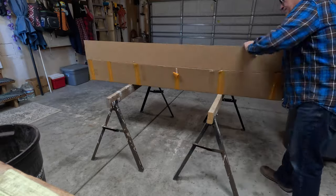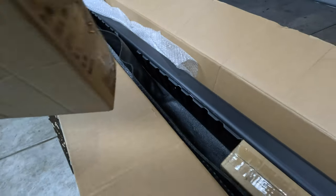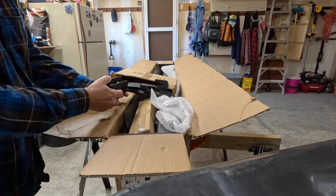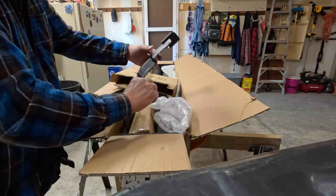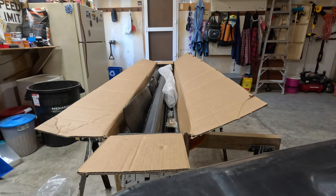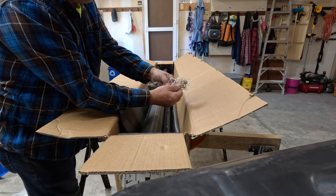Here's what they look like — they're packaged pretty well. I already opened this one earlier but haven't taken anything out yet. This package contains the brackets. For this particular double cab model, there are three brackets on each side and they look like decent, thick gauge metal. They bolt to the rocker panel and the running board sits on top. It also includes all the mounting hardware and the special little nut clips that go up inside the rocker panels on the truck.